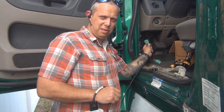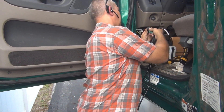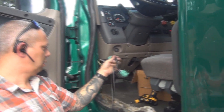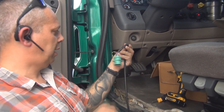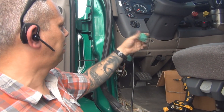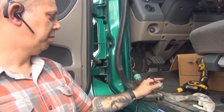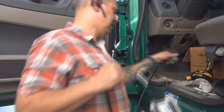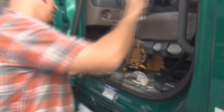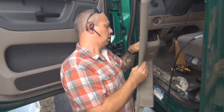The connections on these are pretty simple — they plug in and kind of twist to lock them in. That goes straight into your engine's computer and can read everything. That will also be the access point for the mechanic later to run diagnostics. This keeps it safe so you don't have to disconnect your ELD when you take the truck to the shop. Remember: never disconnect your ELD.